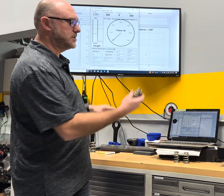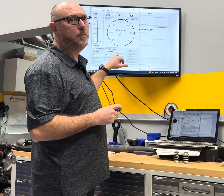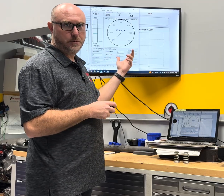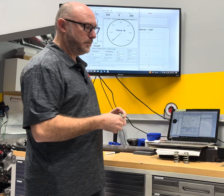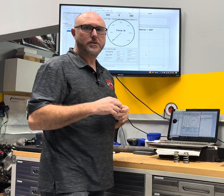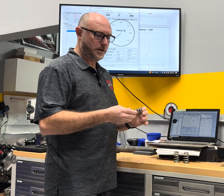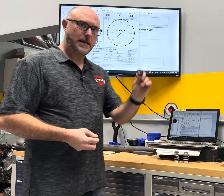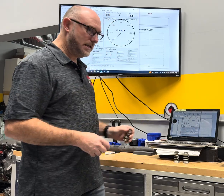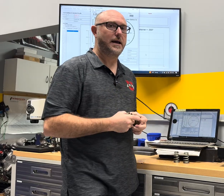When we measure the spring load at a given height, for example, what I would do is put in my spring tester here for this dual spring. My seated height when the valve is closed - my installed height is going to be 2.1 inches. Then I'm going to compress the spring for an 800-thou lift cam to 1.3 inches. You'd take your retainer, take some dial calipers and measure the height of that step - typically around 100 thou - because the inner spring isn't always the same height as the outer spring, so you want to compress that inner spring the same amount.